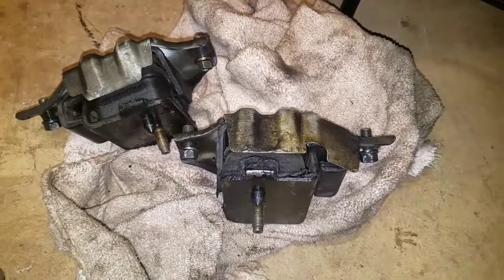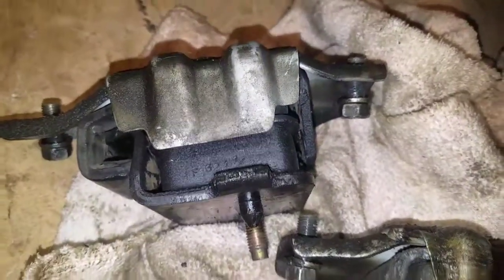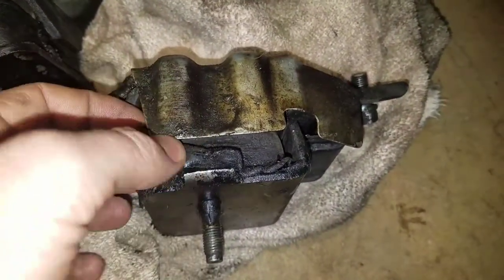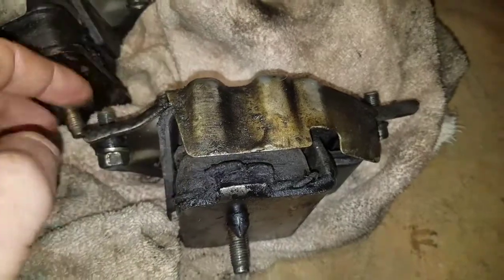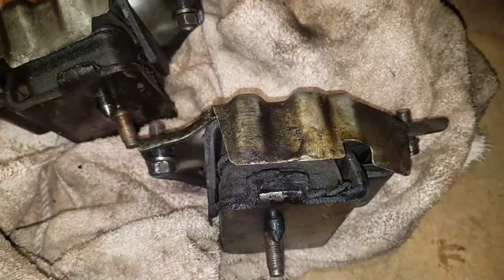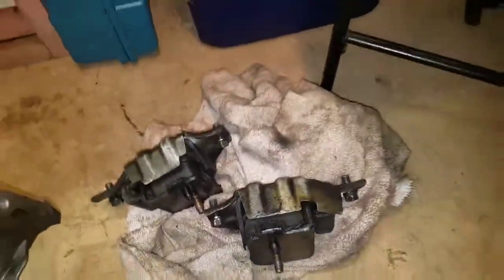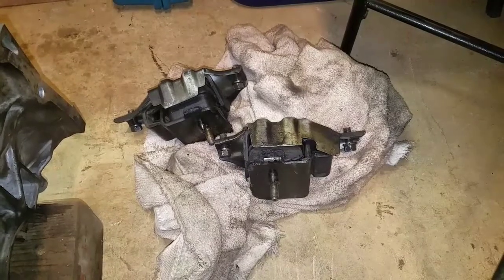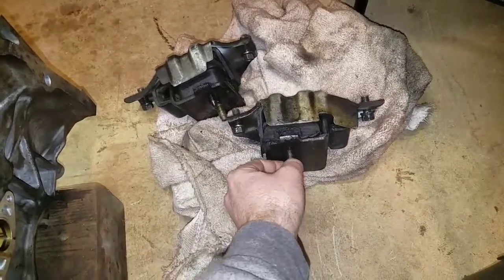The other thing that was wrong with it - I was having a little bit of a vibration problem. These are the stock motor mounts. You can see this is what the motor mount is supposed to look like, but this one, because of the oil that's been on it, has turned it to like a jelly-like rubber and it's actually squeezing out from underneath the metal plate. This is the driver's side one where oil leaks down from oil changes or valve covers. That's what deteriorated it. When I would rev the engine sitting in neutral, you could see the motor move up and down pretty good, and it actually ended up loosening the bolts too.